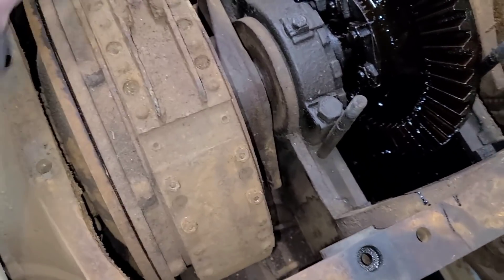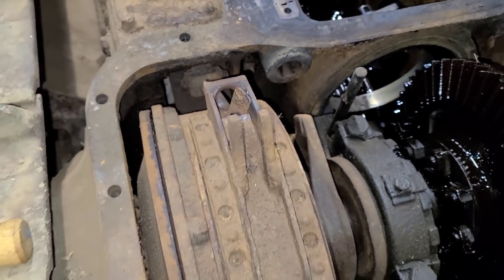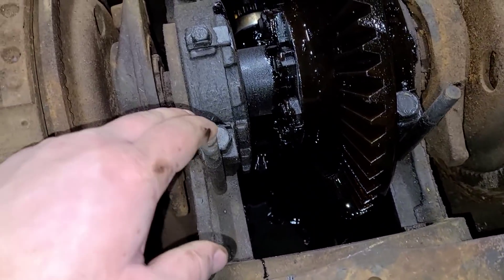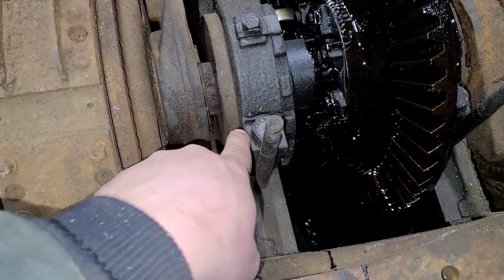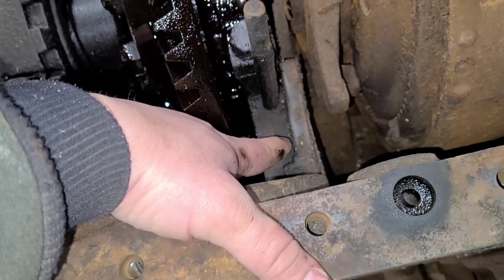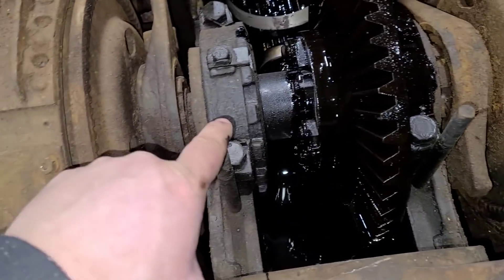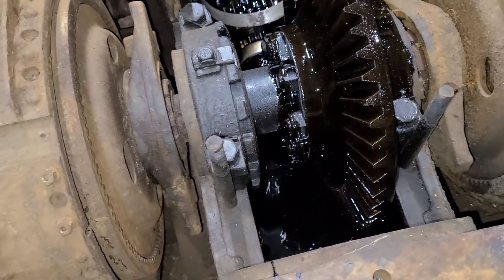But if I take this top part off, this piece should flex back far enough. And I know that this rod up here will flex forward — that should leave enough room to bring the drum by. We need to get the fold-over locks folded down and then pull these four bolts. I already marked these: the way I do it is I mark one dot in the corner and one dot out here, same on the other side. You can't get these mixed up — if you try to put this one on the other side, that dot will be up front, so you can't mix them left to right.